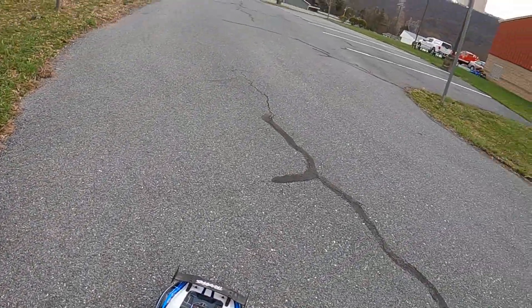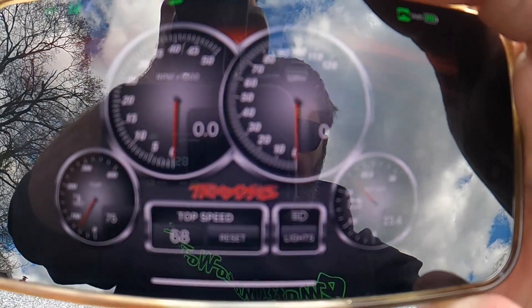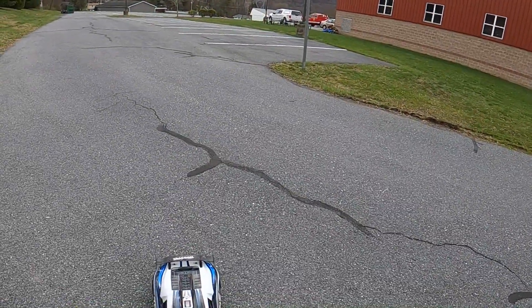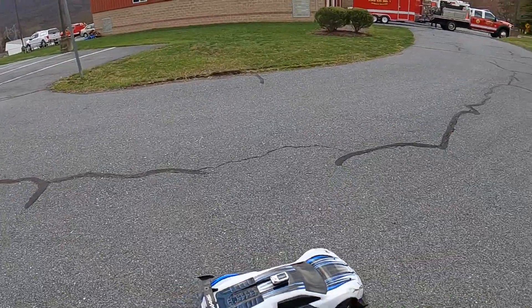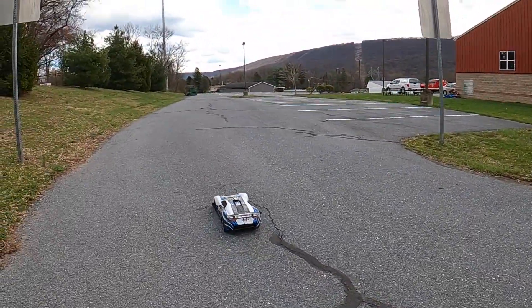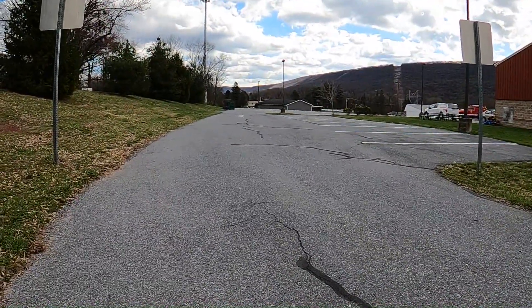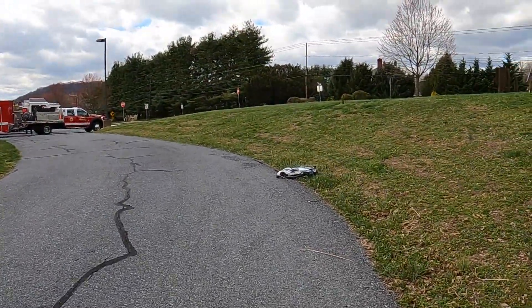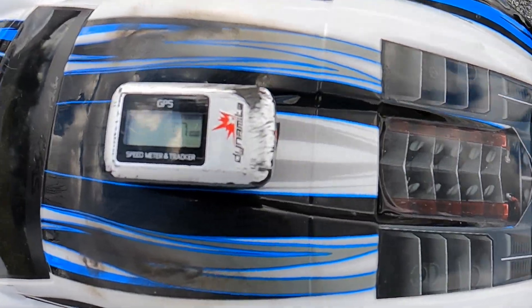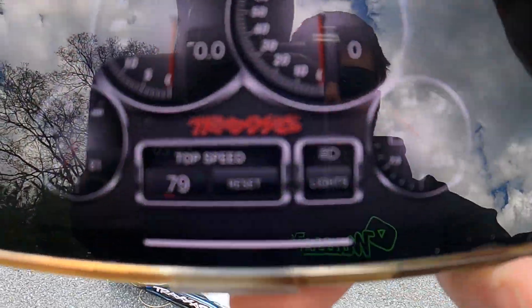Let's see if it says any faster on the app. We're a little bit far off between what the app says we're doing and what we're actually doing. That little rip there was 68 on the app. Motor temp still looks good, so we'll give it another blast. We are down on power a little bit - we're at about 23 volts; I think this gets a high of 25. Batteries are a little bit used. That one: 57 miles an hour actual, and that says 79 on the app - we almost hit 100 as far as the app is concerned.